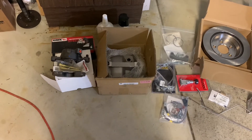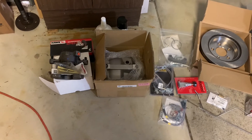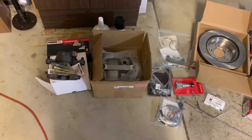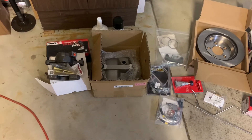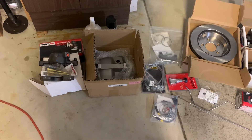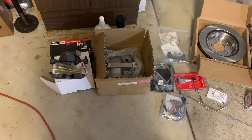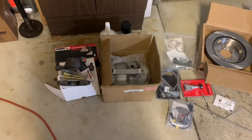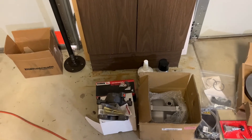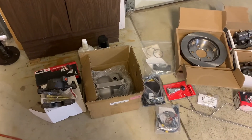I also got the Russell braided line set, which will give me the two front lines as well as the one that goes to the rear axle from the single line going down the center of the vehicle. And then I have a new rear diff cover since I have to pull that apart to get the axles out in order to remove the drums and all those associated parts. I ordered new Redline gear oil — I've always used that with the Ford 8.8 rears with the limited slips. I also have an old Fox body axle from my old 5-liter Mustang that I'm using as a template for drilling the rotors.